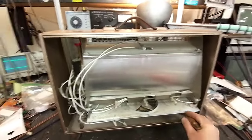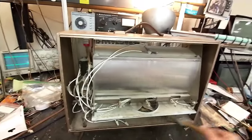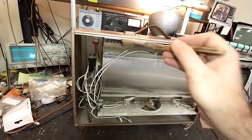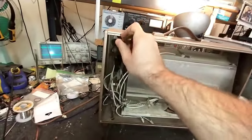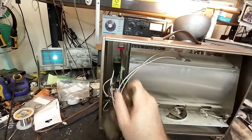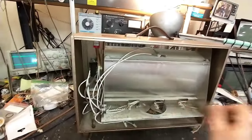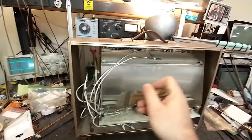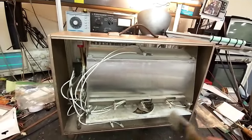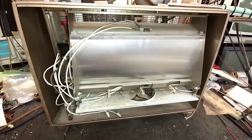I'm going to loosely brush out the dust. The air comes in through the bottom of the unit, pulled in by this fan and then circulated back out the top. Really the only reason the fan is there is to keep the cabinet from getting so hot that you can't move or use it. The hero of the story is the radiant heat element in the front that radiates heat into the room. Let me get this all cleaned up and then we'll work on oiling up the fan motor.